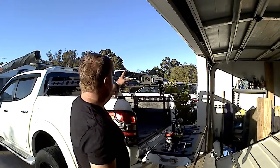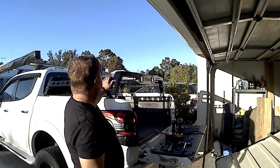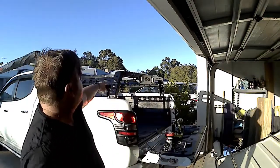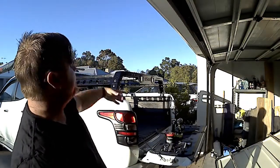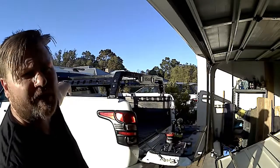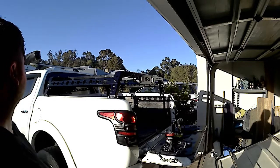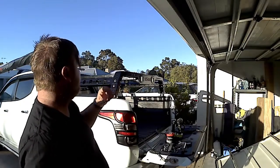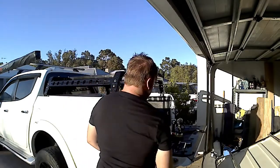It's a choice, but I say on the structural points always put double washers where you can. Elsewhere just a single washer is enough to hold things together, and your structural points, particularly around your railings. So these points, the 2 on the sides, and obviously on the top, the one down and the 2 facing in, if you can use washers on those. If you can see up the back on my ones there where the other railings are, you can see how they've got washers facing those areas, and it's mostly because you've got a wider area, so you want to cover as much space as possible for those washers. So that's just about the washering.